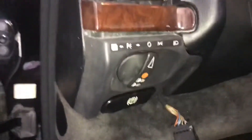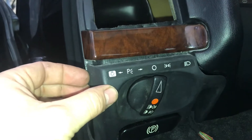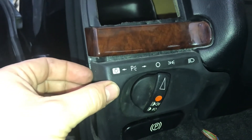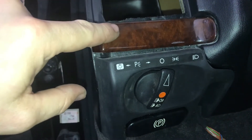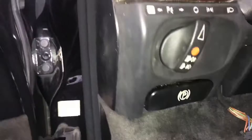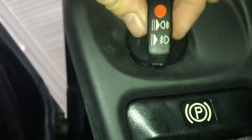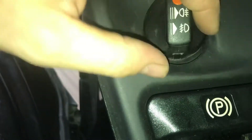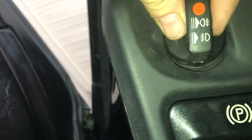This is the part where I got stuck. Once you have all those screws out, this will not come off and you're going to pull on it. I thought I had to remove the wood trim here, which you do not need to do. I found on a forum that if you look right up underneath this switch, there's a little place to pop a screwdriver in, and you're going to push a flat head screwdriver in while pulling — and that's going to pop right off.